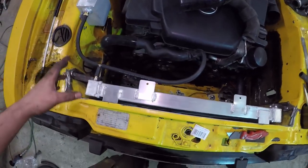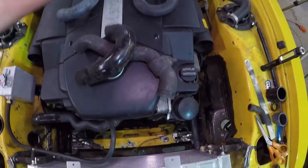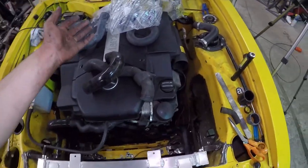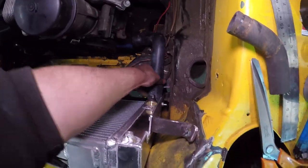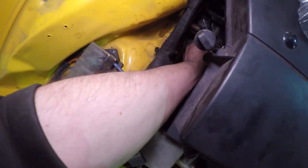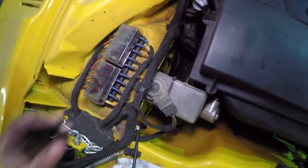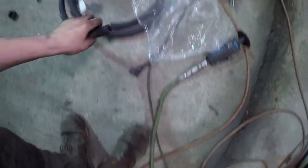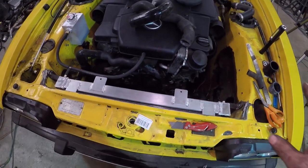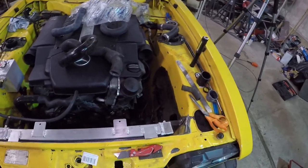The engine won't have much movement so that'll be fine — the only time it'll be a bit of a stretch is when the engine is tilted back for gearbox work. I've raided my hose selections — some brand new VW hoses off the shelf, cut down and altered to fit. Next up is to get 16mm hose around and into that first fitting. There might be enough clearance to allow a natural bend — I've got some pretty good EPDM rubber hose, so we'll give that a go.